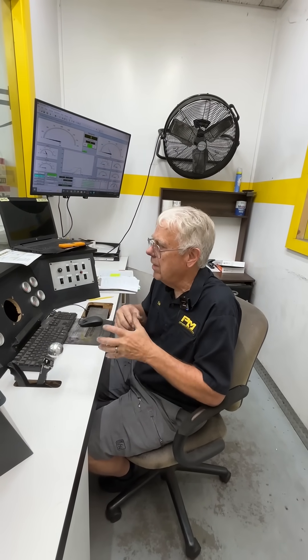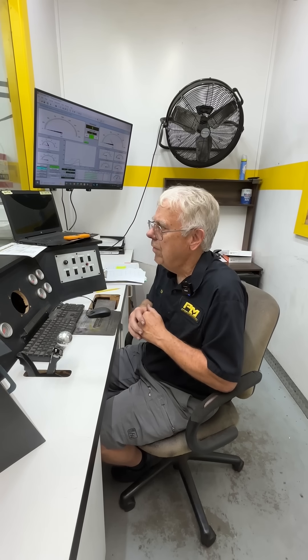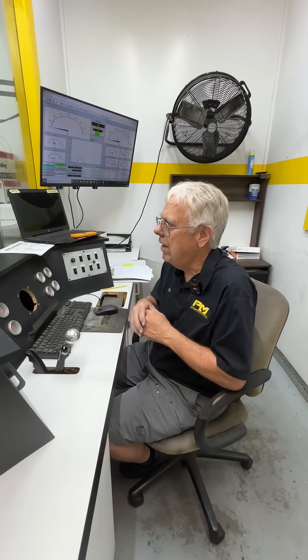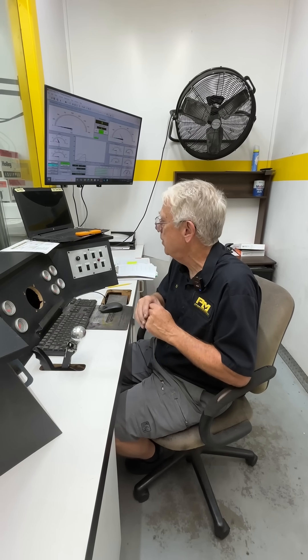What that is, is basically holding the motor at 3000 RPMs and 300 foot-pounds of torque. That's kind of how you're cruising across the swamp, river, or whatever, to make sure that the AFR is correct. So what we did on this — we were about 12 to 1, and as you can see we were about 12.5, 12.4, which is pretty good.